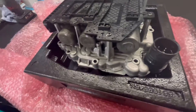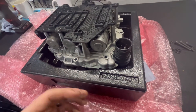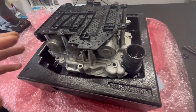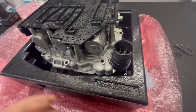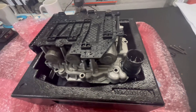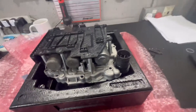We're going to put the mechatronics back on the car, then we're going to fill up the DSG and ensure the level's absolutely spot on. Then we've got to do what we call an adaptation drive. The adaptation drive is where it goes down the road and we put it through its paces - we get it to hit every condition that the gearbox would hit, and then it checks against itself, makes sure it's okay, and eventually it will pass the adaptation drive and the car is then perfect to drive.